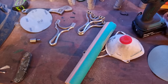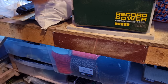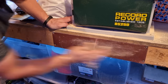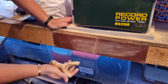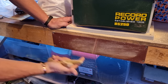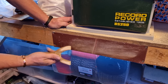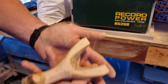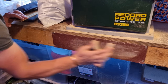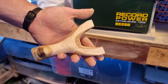Let's do some more sanding. Instead of a power sander, we've looked at our dowel with sandpaper, now we've got a flat surface sanding pad. You can use the workpiece instead of moving the sandpaper, and you can see the sawdust getting stripped away. It actually works very well because you've got more purchase on the workpiece. It's great for getting these flat surface forks — the way I do them — square off the tips. Just another tip: if you don't have the power tools, you don't need them.